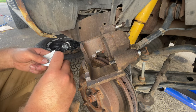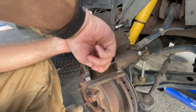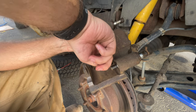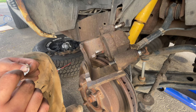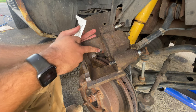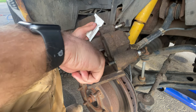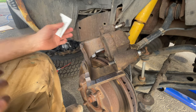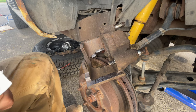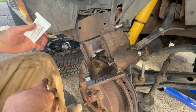Now that you've got all those greased up, just use the leftover grease. I'm going to grease where the brakes are going to ride just to help it initially. I'm going to rub some of that grease back there where the back shoe rides — same thing on this side — and get all that nice and greased up. This is where it meets the control arm. It's not crucial I don't think, but I got leftover grease and I'm going to use it.